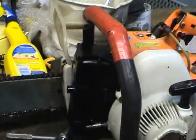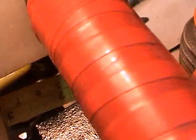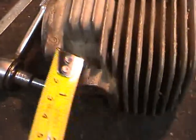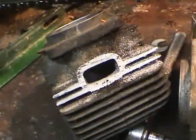The original is just a bit shorter and it stands away from the body. With the exhaust fitted, the distance you need is roughly an inch out from the body of the saw - here it's probably about half an inch. The piece you actually cut off the cylinder goes down to the two bottom fins, which is approximately 15mm - that's the size of the flange you're chopping off. That's the distance and it should work fine.